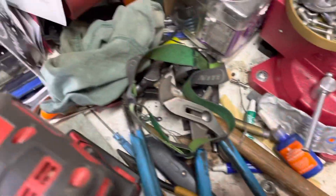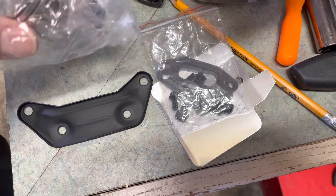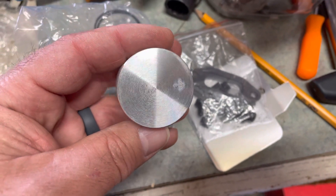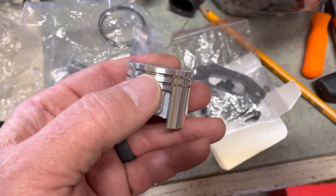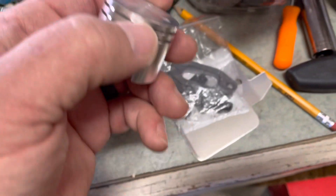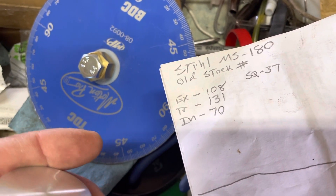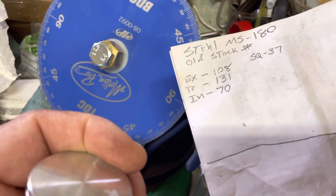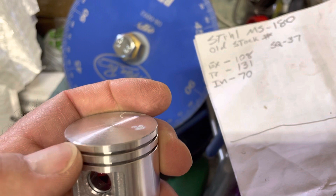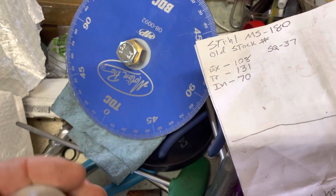Kind of what I'm thinking is going over here with this piston. This is just a quick aftermarket piston — it's like 20, 25 bucks on eBay. Since it was a saw that was a trade slash given, I'm not going to sink much into it. It's a 180 — they're really not that much to buy new. I can take and gain a couple degrees, which would change my 131, and I could probably get it like two degrees. Once you open it up a little bit, give a better shot, and basically open a transfer window up by just modifying the piston. I'll shave this down just a little bit, maybe about half the distance to the ring, and kind of flow it into it.